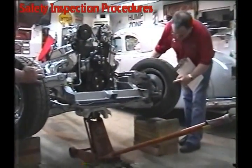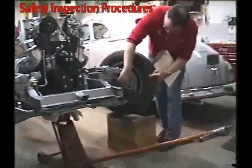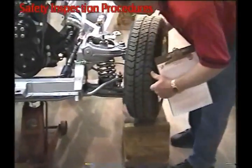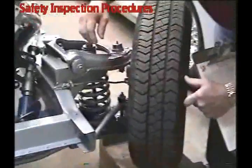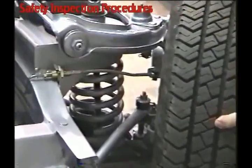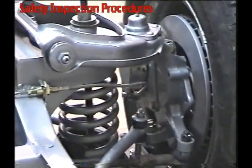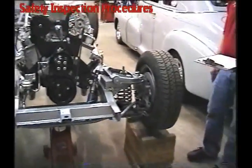When the owner's in the car, have them turn the wheels from lock to lock. You're looking at the brake lines to make sure they don't go banjo — what we mean by banjo is they'll get real tight. This line still has plenty of play in it and is allowed to move up and down. If it was banjo, it would get really tight to the point it would want to tear at the caliper. That's what we refer to as banjo along the lines.